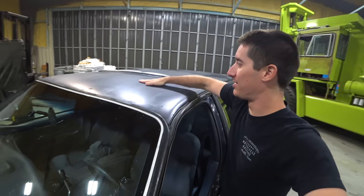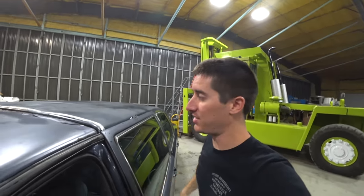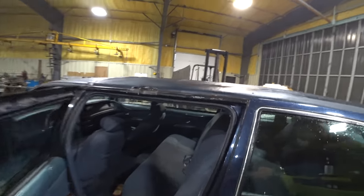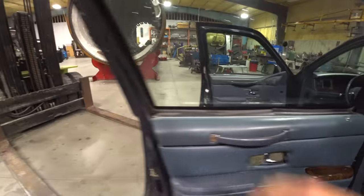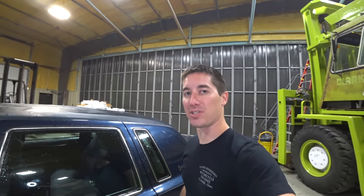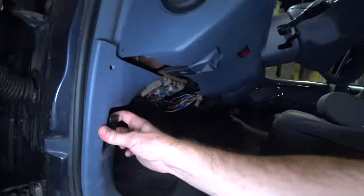On the exterior, the vinyl top is basically a big slice of butter — it's pretty much all trash. There's rust and sealant all along it, and none of it really seals so you get a lot of water getting in. The door seals here are just trash; it's double-sealed and still leaks like none other. You can see rust coming inside the door from all that water. The door check straps don't work on any of the doors — they either flop or they're stuck shut. The door handle covers are gone. The rear HVAC unit in the trunk doesn't work. Doors have to be absolutely slammed or they don't seal at all. The fuel door has to be pried open with a screwdriver because the switch is gone. The trunk release works though, oddly. The adjustable power steering works just fine.